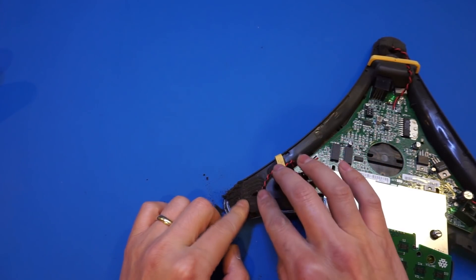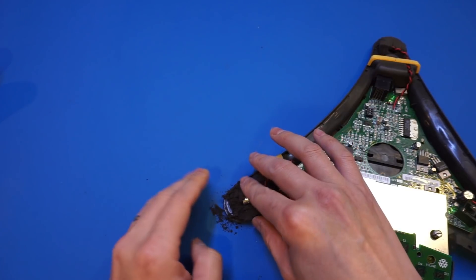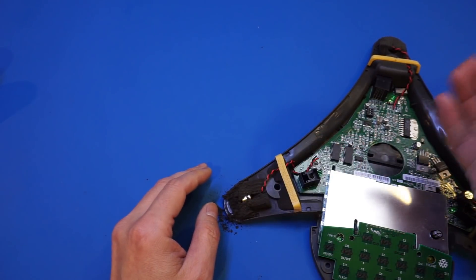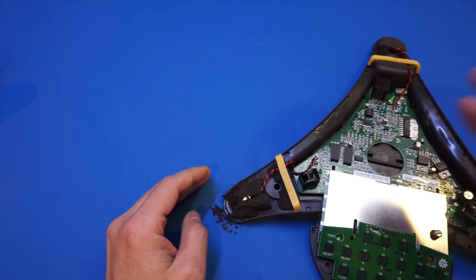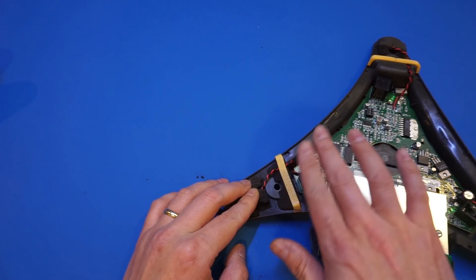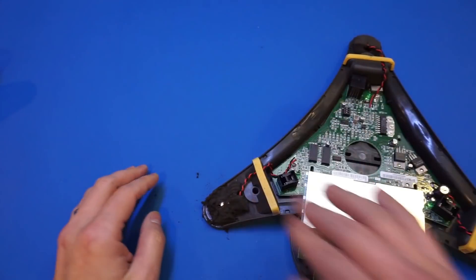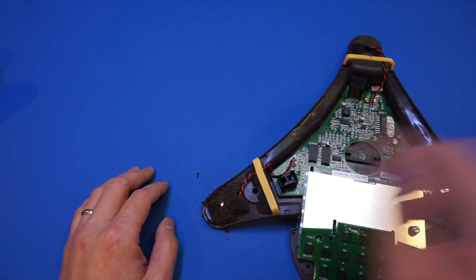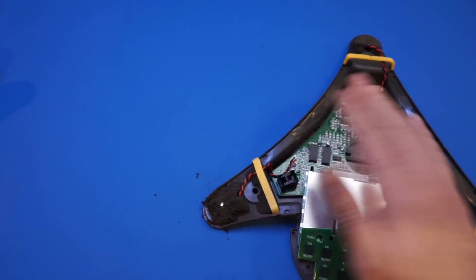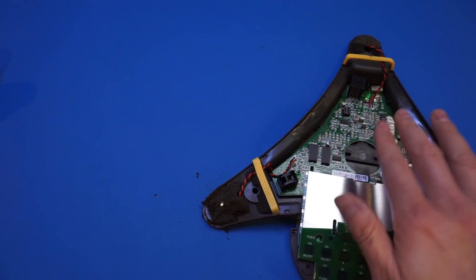So here we have a microphone inside. The microphone is actually facing outward — slightly downward — so the speaker in the center position would prevent the sound wave from the speaker from entering the microphone. We also have a kind of barrier on all three corners, which acoustically shields the inner portion to minimize the sound entering the microphone portion of the phone. This soft material further decreases the vibration coupled in from the speaker, to maximize the isolation between the microphone and the speaker.